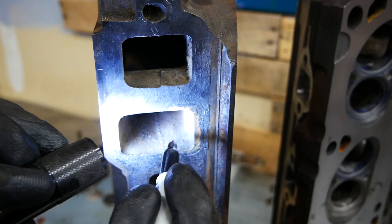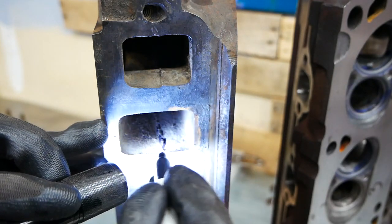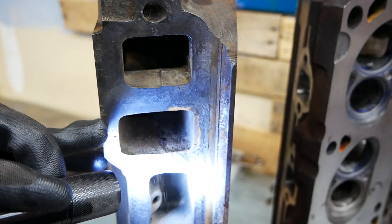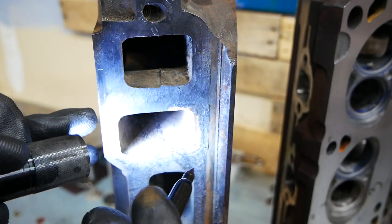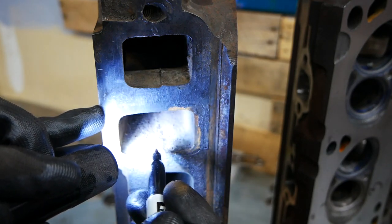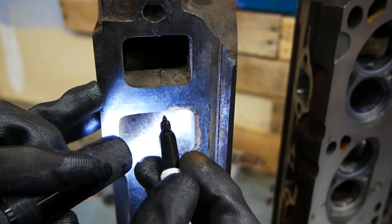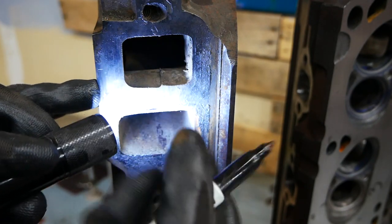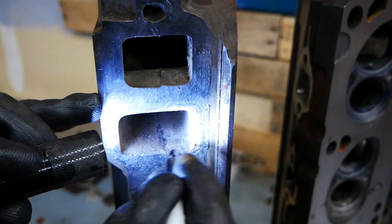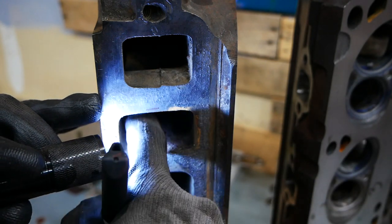On the intake side you can see there's another casting vein that ran all the way through — I'm going to grind all that down. Everybody agreed you don't want to do a lot to the floor; you want to do more to the roof and less to the floor, and a little more to the long curve side and less to the short curve side. The last thing I'm going to do is gasket match it — put the gasket over the top, draw where it matches, grind all the way to that line, and fade it in so the air compresses a little and speeds up going into the valve.